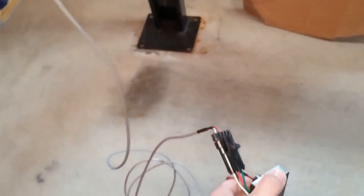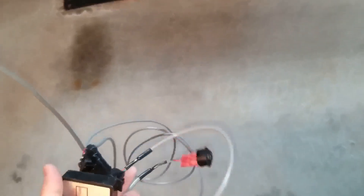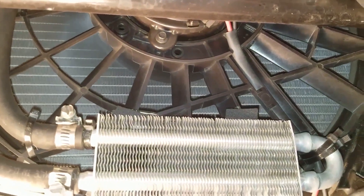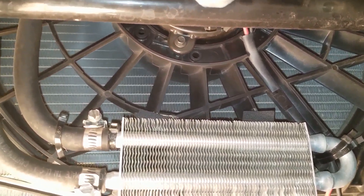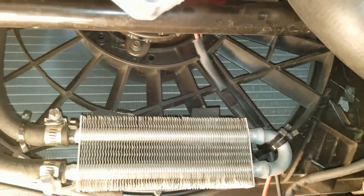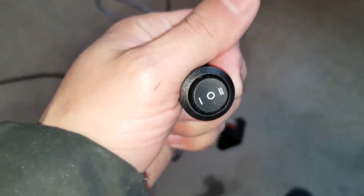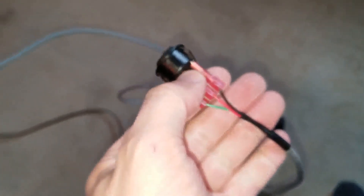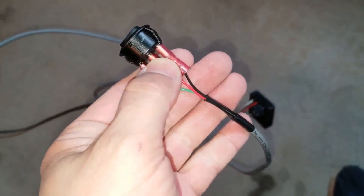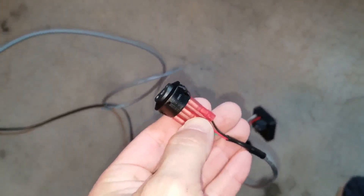About 10 seconds later, the wire harness is connected to the module and the switch is connected to the other side. Let's test it — I'm gonna hit the one hash mark. There you go — that feels like low. Now let's hit the two hash marks. Oh yeah, awesome! So the one hash mark is low and the two hash mark is high. The instructions have the wiring listed wrong — the black is in fact low and the green is in fact high, despite the instructions saying the opposite.